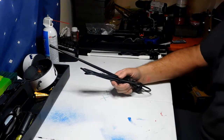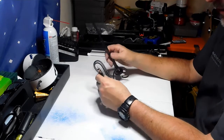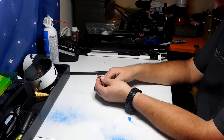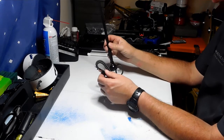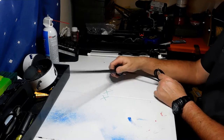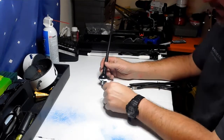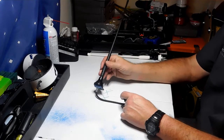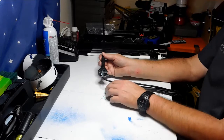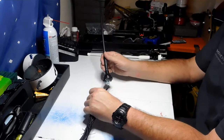A lot of people don't realize that an antenna is just like any circuit in a 12-volt system — you have a positive and a negative side. On these car antennas, the outside of the casing where it plugs in is the negative, and the tip is the positive. Most people think that on a car this is the whole antenna — but no, this is only half the antenna. The other half on a car antenna is actually the car itself. The car is what's called the ground plane. This aerial is the positive side, and the metal base that attaches to the car is the negative side. It works because your car's chassis is grounded through the battery, completing the circuit.